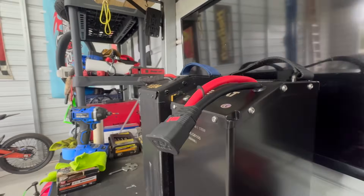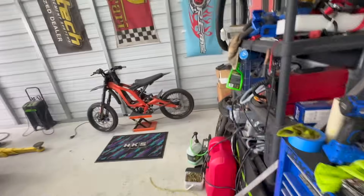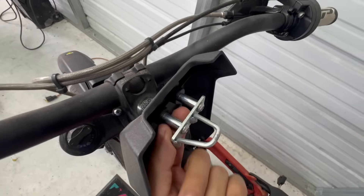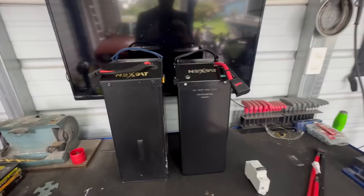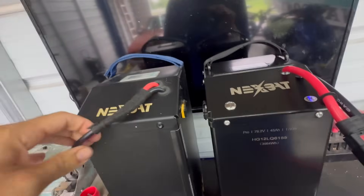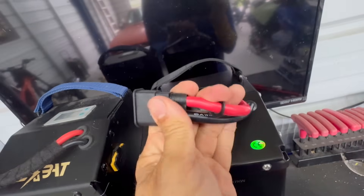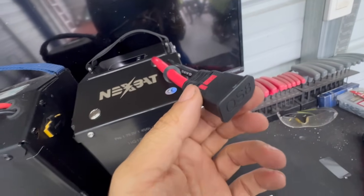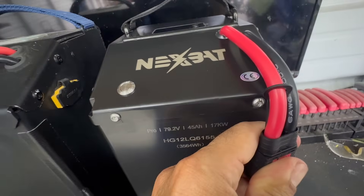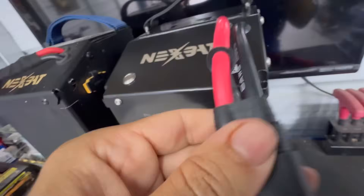For comparison, the old battery is actually bigger — taller — than the new battery. So I'm interested to see: I believe we should be able to take the spacers off the door here that were adding extra height. That's kind of cool. You can also see visibly bigger cables — what was on the old battery I believe is eight gauge, and the new cables are six gauge, so considerably less resistance. That's a really significant increase in cable size — you can see how much more of the QS8 connector space is now filled.